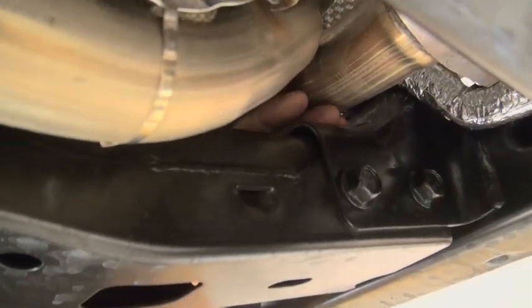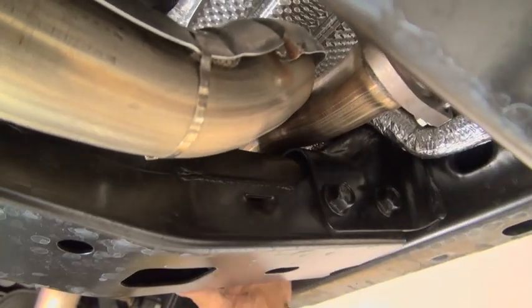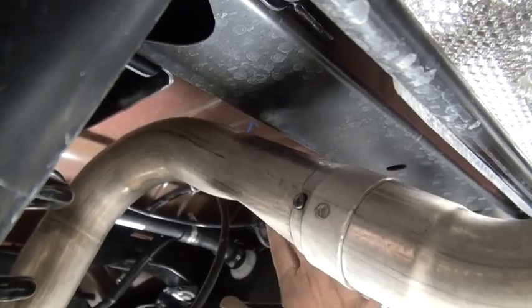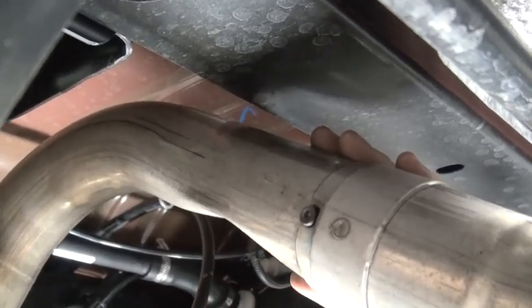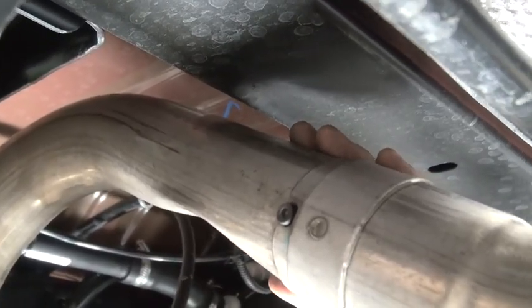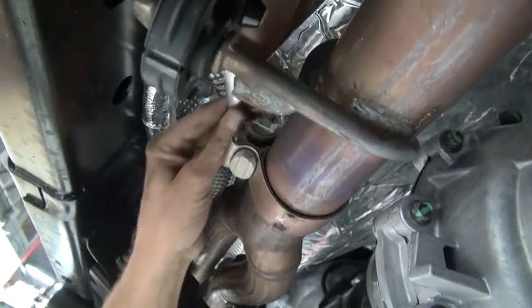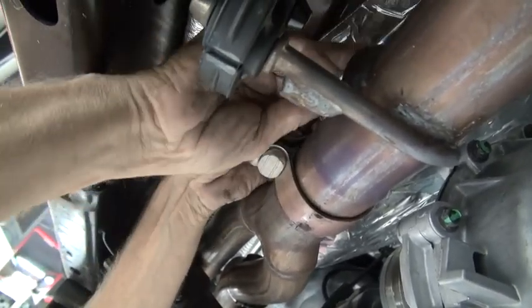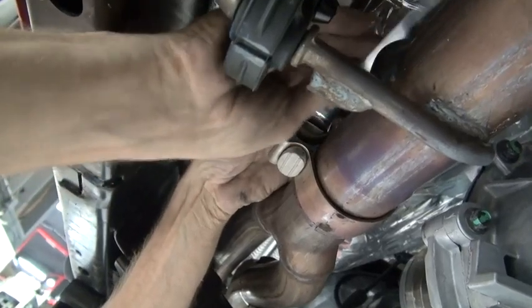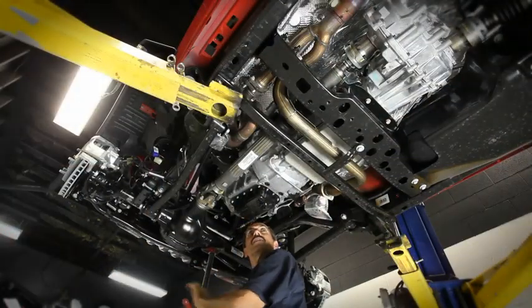Look closely by the flange where the driver's side pipe bends up over the front cross member. Also check where the pipe goes up over the rear axle — the top of the pipe gets pretty close to the floor cross member there, so make sure you have clearance. We've checked all our tolerances and everything clears nicely. The last step is to tighten up the clamp on the Y pipe. Once that's tightened, let's move forward and check what kind of clearance we've gained on that front driveline.